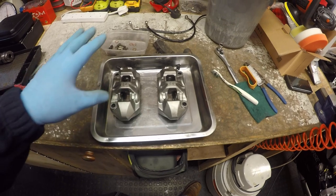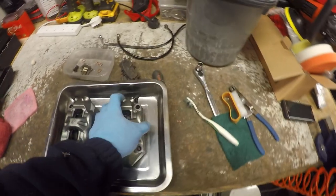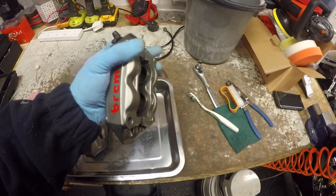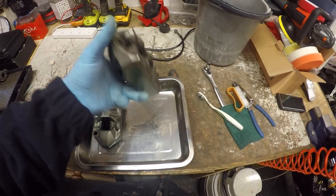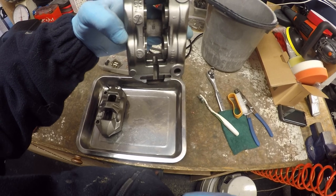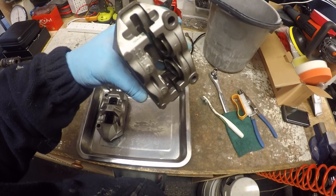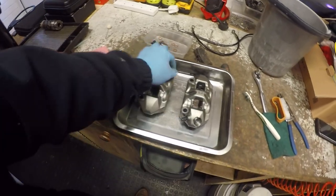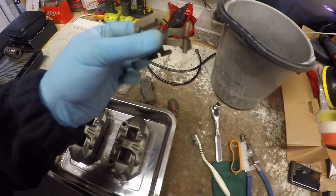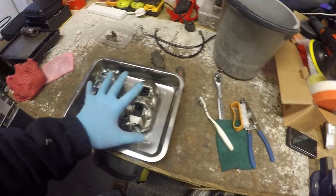I do try to limit the use, but they're all cleaned and ready to put back on the bike. In case anyone is wondering why I'm using water and not pure brake cleaning fluid - I hold my finger over the orifice the whole time while cleaning, so water shouldn't get in. The very last thing I do is hold the caliper upside down and squeeze the pistons back in, which shoots out most of the brake fluid and would take any water that entered the very top of the orifice with it. It's never been a problem.